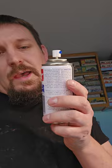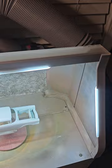This is part two of the video on the 57 Chevy that we're working on, spraying with Tamiya lacquer paints. I've got my Tamiya fine surface primer that I just pulled out of a can of warm water — it's been at warm temperature for the past week or so. I put it in warm water to make it so that the solids all mix together with the paint really well. I'm gonna shake it up really good.